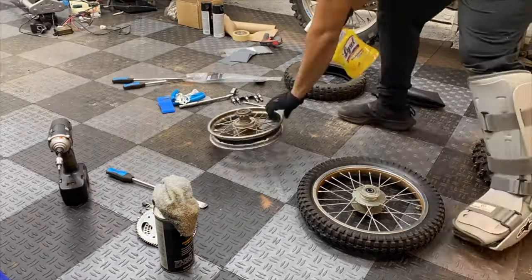What I'm gonna do is add a layer of this 3/4 inch thick dense foam to the bottom battery tray and the inside of the frame, just for added protection for the lithium battery pack. And here's how that looks. This just helps absorb any sort of vibrations from impact whenever you're off-roading or hitting bumps on the road to protect the battery and the electronics, since this is usually the most expensive part of these type of builds.